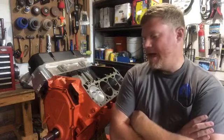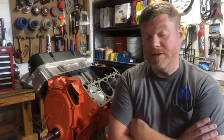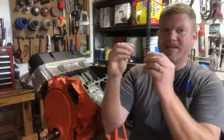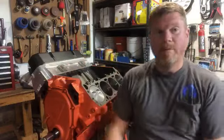Why I bring up garbage gasoline in this sense is that, believe it or not, and I have heard about this, I've seen detriments of it, the gasoline doesn't burn or burns so poorly, so inefficiently, that it hangs on and clings to the sides of the cylinder walls and the top of the combustion chamber. And then on the wrong cycle, it ignites again. The molecular bond is so unstable, it's like, oh, okay, we're going to be gasoline again. And then it goes off. That actually happens, and that's just because of the volatility of gasoline as a molecular bond. We're getting into it again, but that's why they put the recommendations on, like, run this gas.